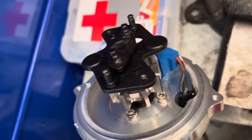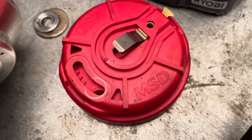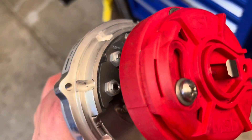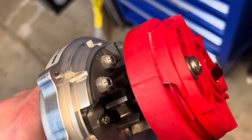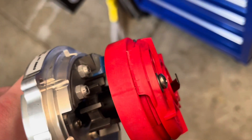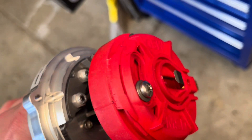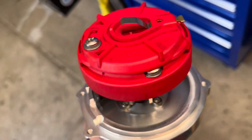I'm about to put this cap on and I'm going to phase it out by 15 degrees. I have installed the two-piece adjustable phase rotor - it's brand new, just dirty. Now that it's installed, I put it 15 degrees out in accordance with the recommended initial installation instructions. This is a counter-clockwise rotating distributor because it's Pontiac.